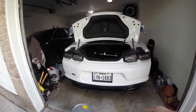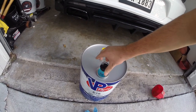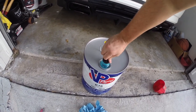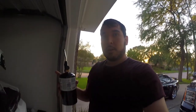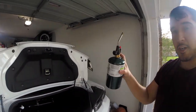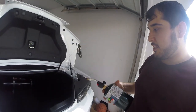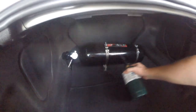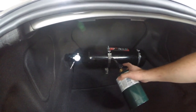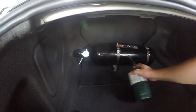We're closing the tank back up - we don't want it venting to atmosphere because the more it's exposed the more it'll lose potency and power. For heating the nitrous bottle, I'm using a portable propane tank with an auto igniter. You ignite it and move it back and forth along the bottle, watching the pressure go up. You don't want it going too high - you just heat it enough to get it around the 950 PSI mark and then you're good to go spraying.